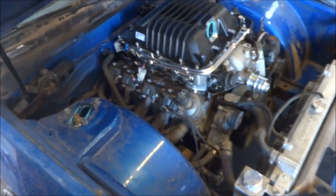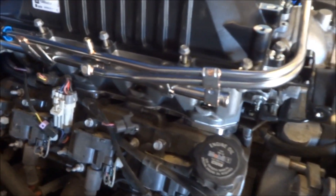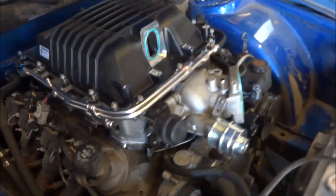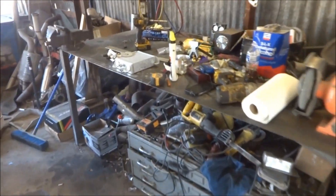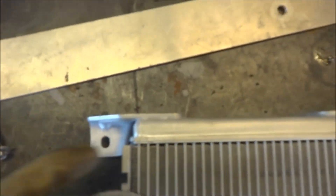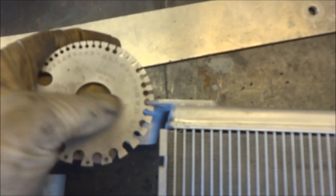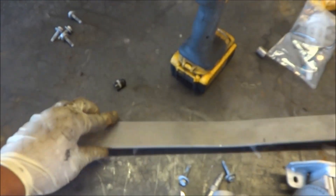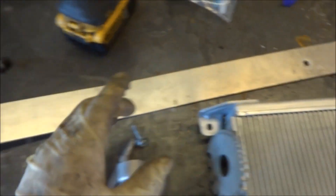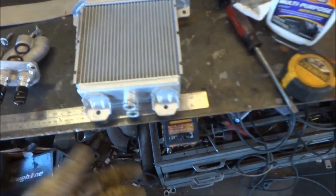Some more progress — I bolted down the supercharger to the engine already. That adapter plate, I forgot to mention, comes with its own bolts of the correct length for the spacer, which is nice. I took off the brick from the lid so I could reinforce it. I was looking at the thickness of this right here and it's about 11 or 12 gauge. I got some sheet here that's about 2 inches tall and about 4 inches long, so I'm going to cut a section out of it to hold it on the back there to reinforce it.